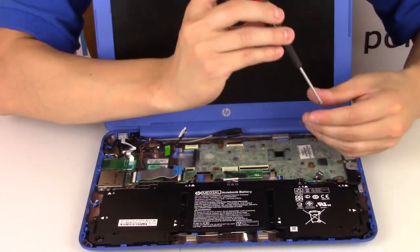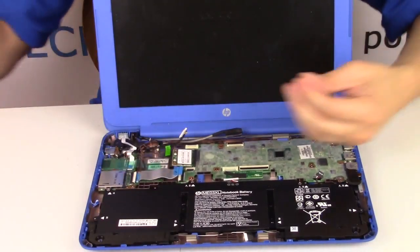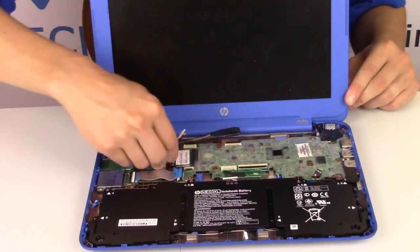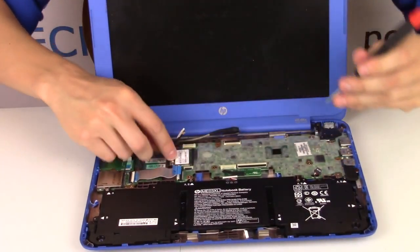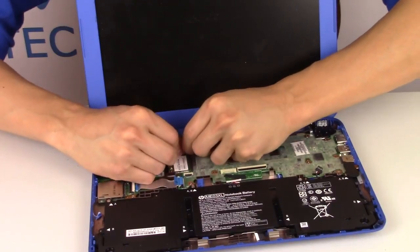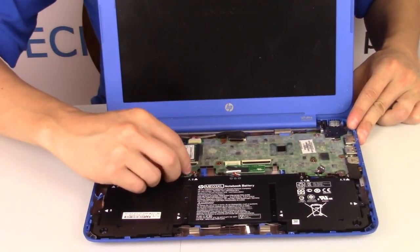Missed one screw right here. Next I'm going to put my wifi card back in — slide that in there, put the screw down, plug my antenna back in. These are kind of a pain — sometimes the only way is to hold it, get it right where you know it should be, and push it down with a screwdriver. I'm going to plug back in my power jack. It's always a good idea to take a picture of all this stuff so you know where everything plugged in, because you don't want to think you plugged everything in, close it all up, and realize you didn't plug in your power jack or your speakers.